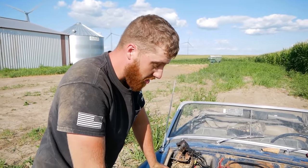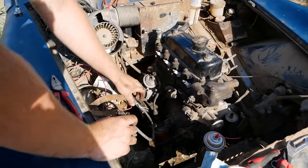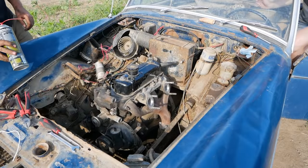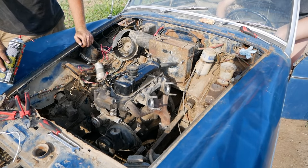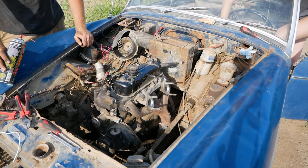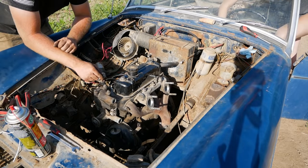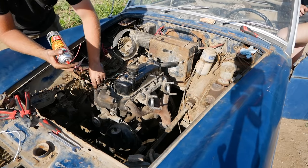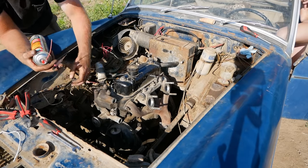Clean up our cap and rotor, put it all back together. Throw a little gas down his throat and see if she makes noise. Let's do it. I got my test light on so I can watch to see if our points are working. Go ahead and crank it a little bit, Mook. There might still be some brake clean in it and it might make some noise. I don't know. Find out. Our light is pulsing, which means we should absolutely have operating points.